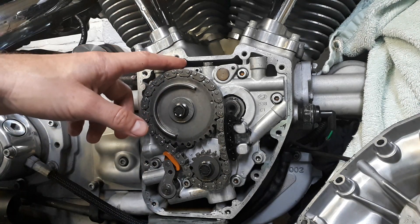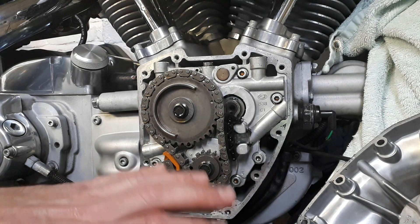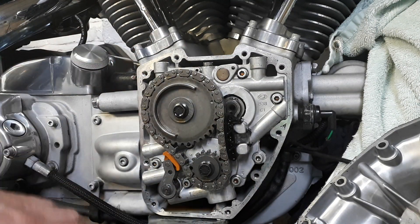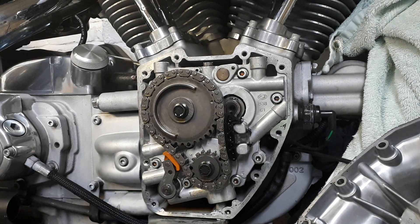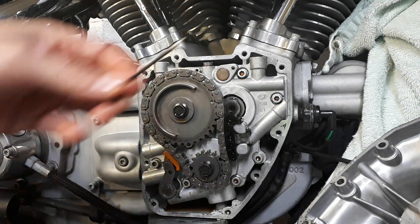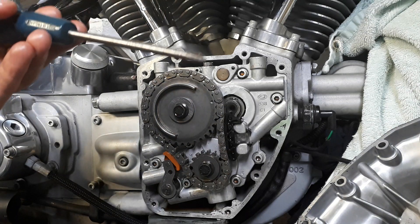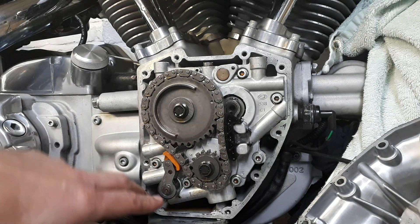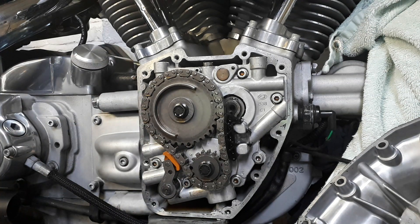We're going to check both the front and the rear. All you gotta do is take the exhaust off, take the peg off, get everything out of the way, and take the cam cover off — and there you have it, all exposed. You don't need a lot of tools: you need an Allen key to use as a pin, a flashlight, a Phillips screwdriver, a dentist mirror, and of course the tool that unloads the front tensioner. You can buy it on eBay or fabricate one yourself like I did.